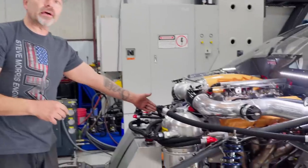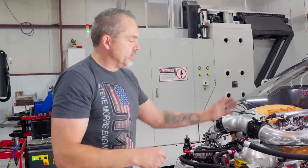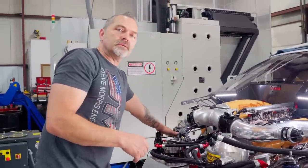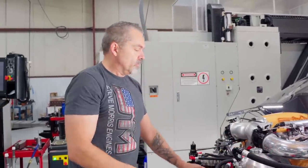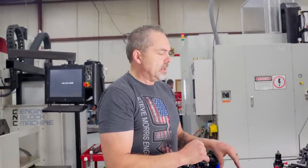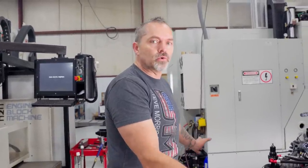You see everything right down to the alternator, the fuel pump, oil pump down on the bottom, oil filter over here, tank. We pre-filter all the oil, so all the oil that comes out of the engine gets filtered first, then sent to the tank, so the tank is always clean. When we put the oil coolers back on, for this part of the deal we're not going to bother putting an oil cooler in it. I'm going to figure out how to do a better oil cooler system and a better trans cooler system. So right now I took those two small radiator coolers out of the car.